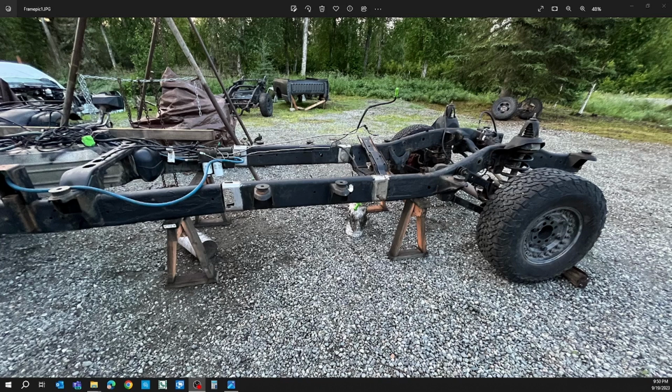So for this section, all I did was take measurements on my body mounts, distances center to center. I also took some measurements cross square from there to there and there to there, just to make sure everything was lining up, measuring up like it should. Slid those sections on after they're all cleaned up. I got it tacked in place really well, and that was the front half.